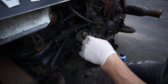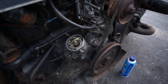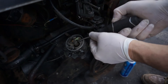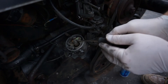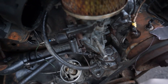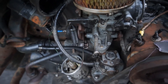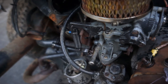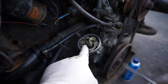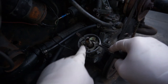Now we're down into the actual points. The distributor is kind of oval shaped — it's got a high spot. When it hits that high spot it pushes that cam lobe, bop bop bop. There are little teeny pads down there that spark. I'm going to turn the motor over since I know it almost started. We know we've got spark — let's get you guys right down in there to see the spark too. You'll see it right here on these pads where it opens and closes.